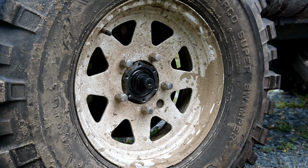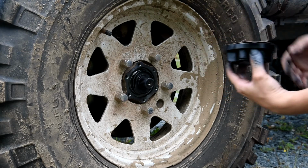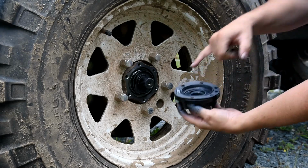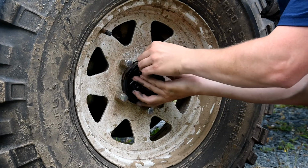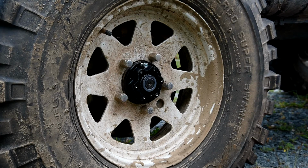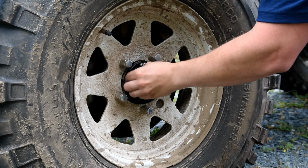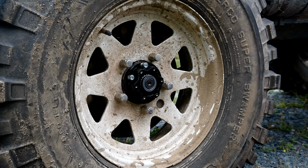Fairly simple. So we'll take our gasket and our hub. And I'm gonna take at least one of these fasteners. Now I'm doing this in such a way to hold the gasket in place, just so it doesn't run away on me when I go to put it all together. Just get a couple of threads on there. Just enough to hold it in place. Now, because these don't go nicely with the cap on, I'm gonna have to fully install and tighten these before I put the faceplate back on. Otherwise, we won't be able to get the rest of the screws in, so that's what we're gonna do. We'll get all six of these in.